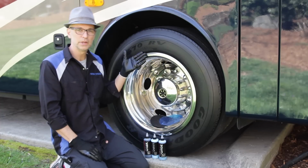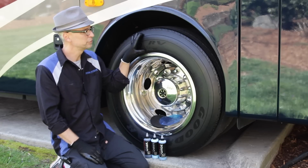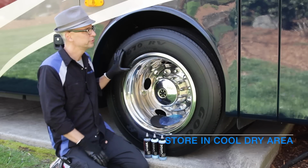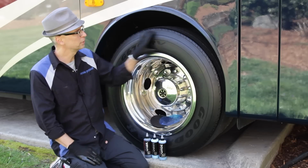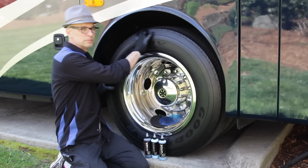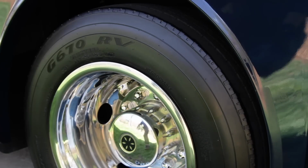So this one, when not in use, this whole rig is elevated, so it's a good idea if you take your tires off or elevate and keep the pressure off the tire. That's a very good way to preserve a tire. A tire cover is also a good option to block the UV rays, as well as a coating, a Renew Protect coating. But you want to make sure your tire cover does not hold in moisture. It's not like a full vinyl cover that would hold in moisture against your surface.